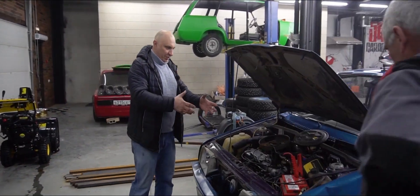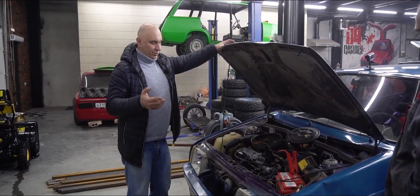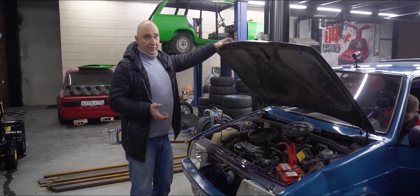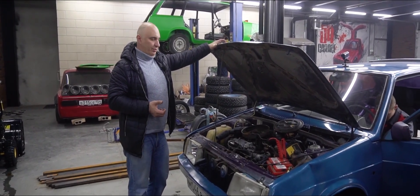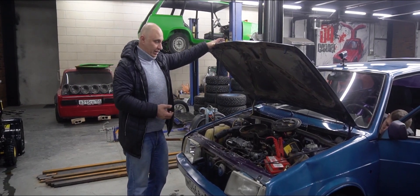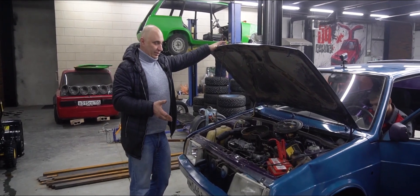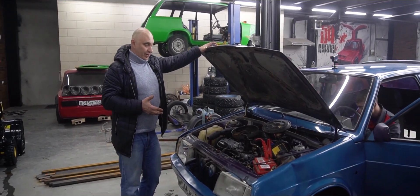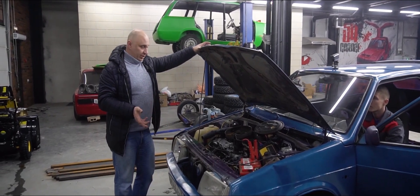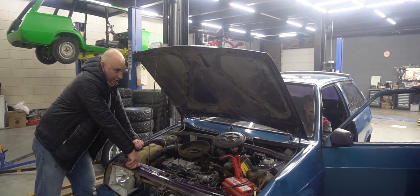So after putting all of this together and installing four bearings made from leather belt, the engine might have started with just three, but after throwing a fourth one into the mix it was struggling. The starter motor wasn't capable of turning over the engine, which is why we were pushing the car back and forth. Even if you dump the clutch in third and fourth gear, the wheels lock up since the motor won't let them rotate. But we were able to free the engine up a bit, and now the starter motor is spinning quite happily — it's time to let her rip.